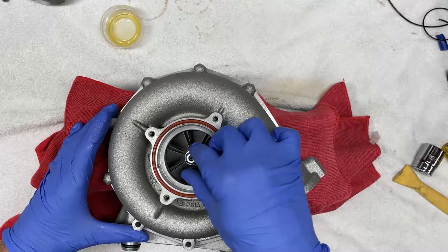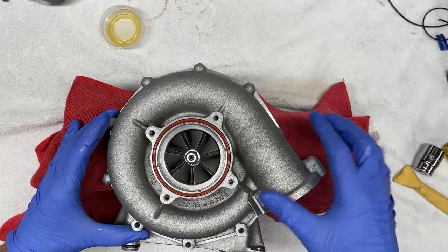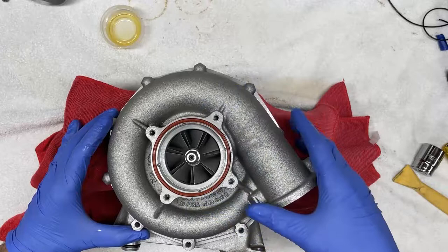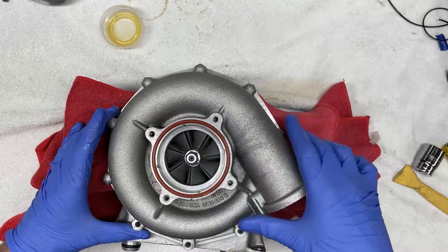What I like to do is every once in a while, I spin the impeller blade to make sure that it's not jammed or stuck. Like right now, I'm touching it ever so gently to illustrate that I cannot spin the impeller because the impeller is stuck, it's wedged. It is stuck here because of the interference. So you want to remove and wiggle the housing ever so slightly to prevent contact so that you can spin the impeller by hand. So now that you have it lined up, you want to make sure all your holes are lined up.